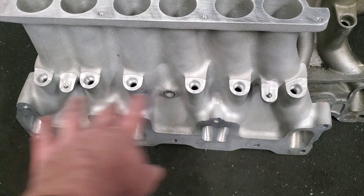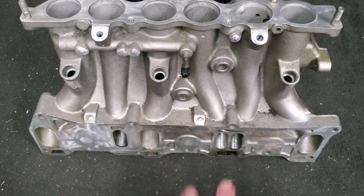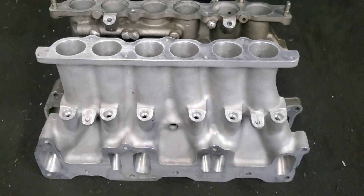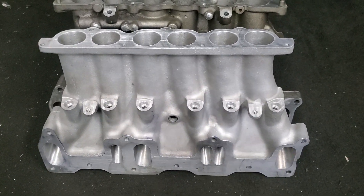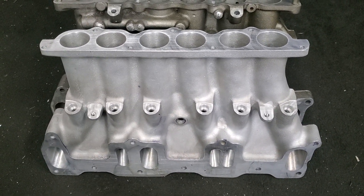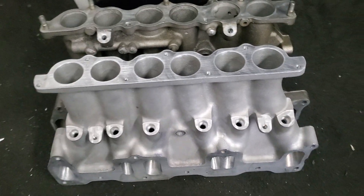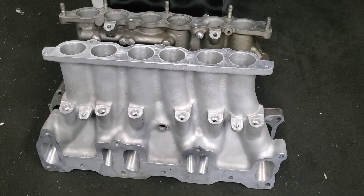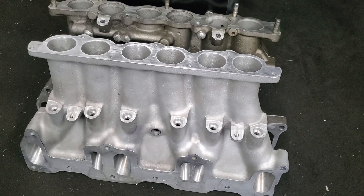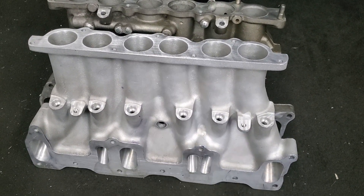Now you have six injector ports, with a total of nine when you add your primaries in, versus the OEM which only had three injector ports on the secondary and three on the primary, giving you six. So now we're able to add three more injectors and optimize our fuel flow for the capacity and horsepower we need. We run two stages of injectors — smaller injectors on the primaries and bigger on the secondaries — whereas in the past, we always had to max everything out because we only had six injector holes.